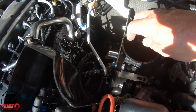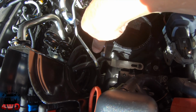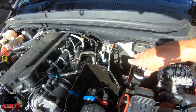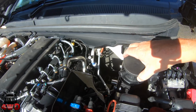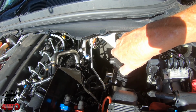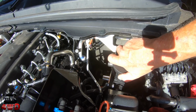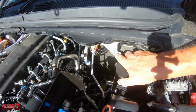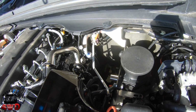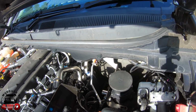Anyway, they're in place. The catch can has a washer that plumbs up against that, and that's where your hose actually goes onto. So now that that's in place, put the filter back in. Now I don't know which way this lid is going to wind up facing yet. Anyway, it goes on something like that, and then just twists and it's done up, and that's all there is to that. So I'll continue the plumbing.